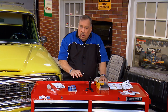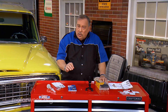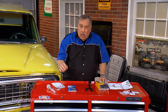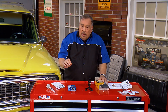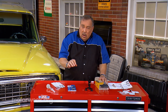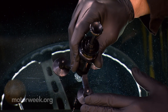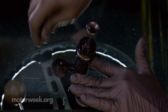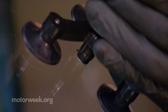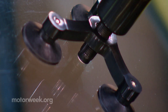The big thing to remember is that when you get one of these stone chips, you have to treat it as soon as possible. The longer you let it wait, the worse the repair will probably be. That's because dirt gets in there and works its way into the resin as you're filling the voids in the glass. That dirt shows up so that instead of having a crystal clear repair, you may have lines in it caused by the dirt because you didn't take care of it soon enough.